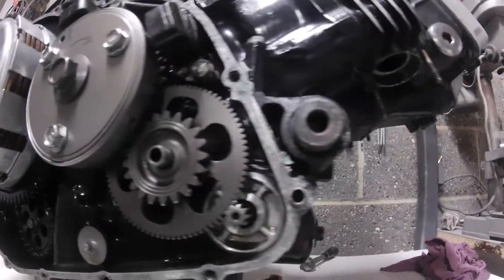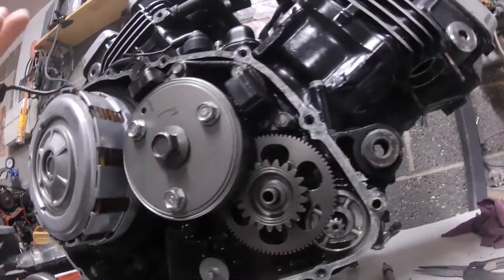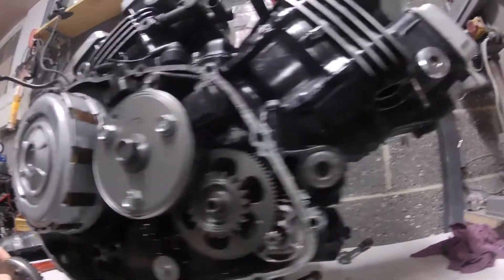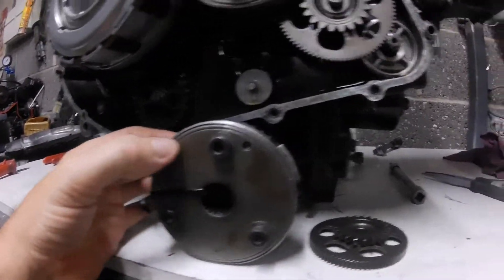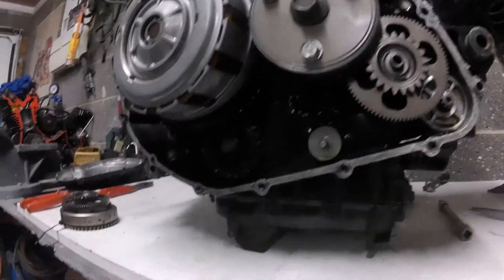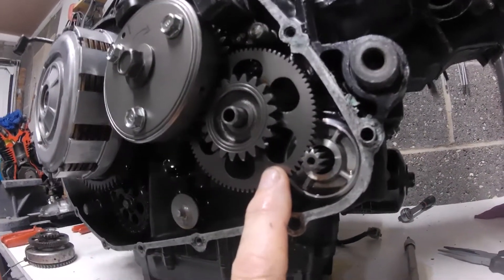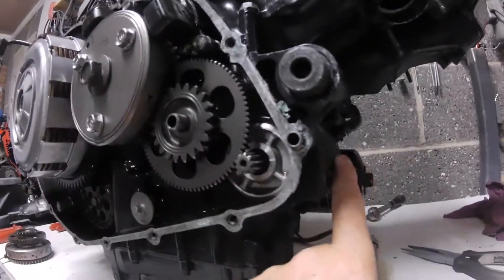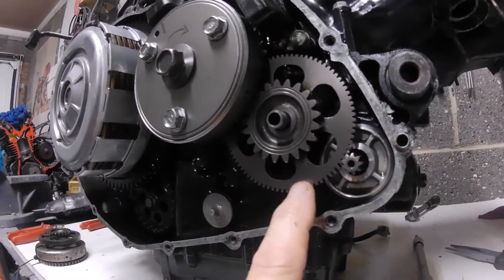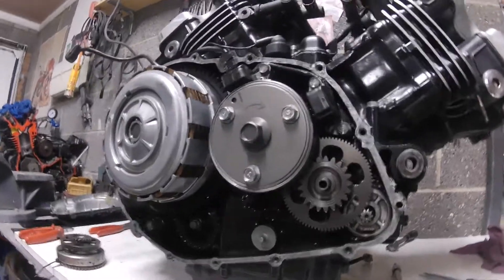There's sheer DNA from the VFR 750 all the way through to this bike. I've also got another starter clutch for a 750 Interceptor with the corresponding reduction gear. Just to reiterate: when you buy your VFR 750 starter, you need the reduction gear that comes with it. If someone is breaking the engine and selling you the starter, ask for the reduction gear as well. You don't need the pin — the pin is the same.